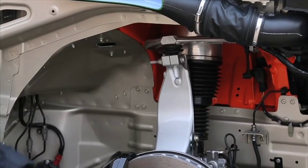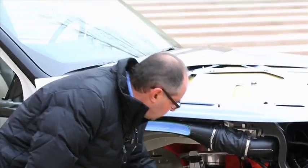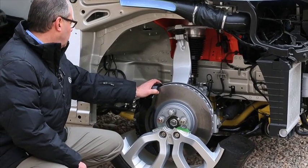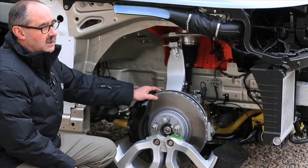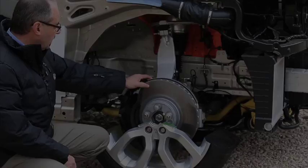This component up here is the upper control arm, which is a hollow cast aluminium component. And if you look at these two black parts here, they are made out of high strength forged steel, primarily because in that application the most efficient and lightest structure to use was high strength forged steel. And you can see from the lower control arm, that's enabled us to design the part with a significant amount of weight saving in terms of reductions and lightness.